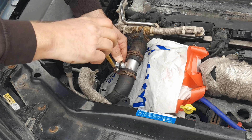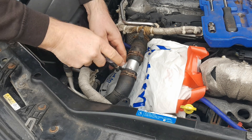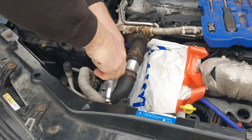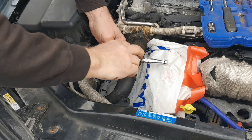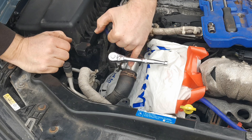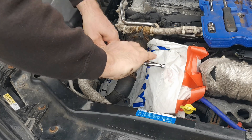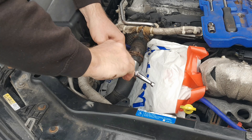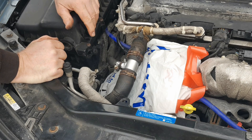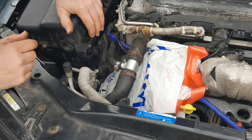When you are doing these clips up, apply a little lube into the threads. You'll also find that these are an awful lot easier to do up if you use a small socket - these Jubilee clips are usually a 6 or a 7. Make sure that your clip goes on the T body side of the flange so that the hose cannot pull off. Just nip it down hand tight - no need to go mad, don't crush it. You could paint the T piece before you put it on if you want it to be body colour or black.